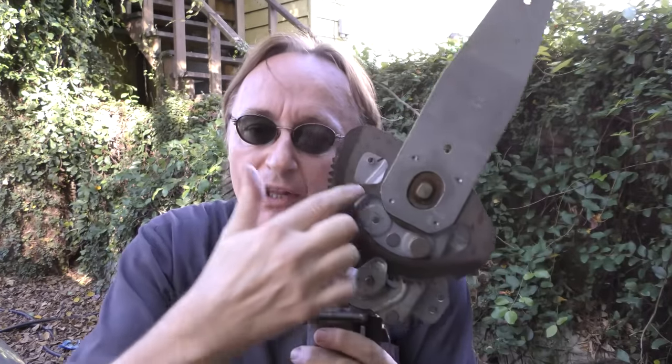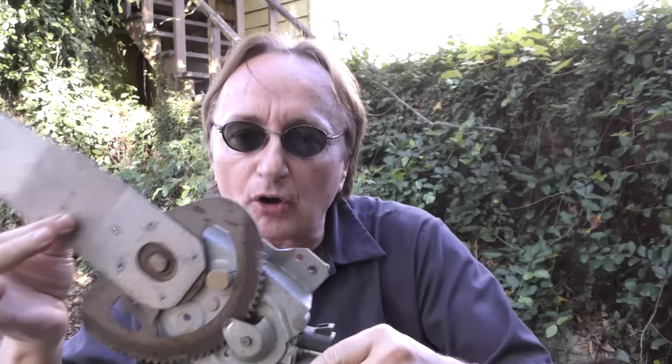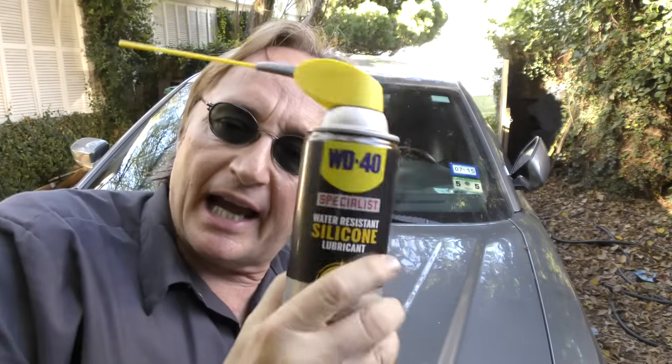That's a small price to pay — if you let one of these window motor regulator assemblies go bad, they can cost three or four hundred bucks for new ones. Just by lubricating, not only will they work smoother but it'll make the motor work less hard and it'll last longer. So before your power windows start sticking and binding, you might try lubricating with a little spray silicone and save yourself a lot of money in the long run.